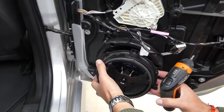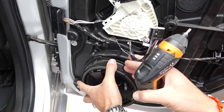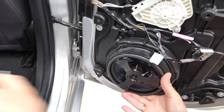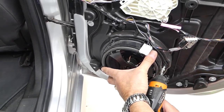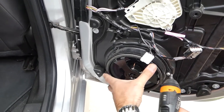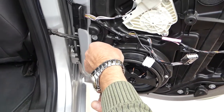When you're ready to install the new speaker, make sure the cable is pointing up — it only goes one way. Also make sure none of the screws are attached to the speaker's magnet on the back; if you're missing a screw, check there first. Then tighten it down with the same screws.